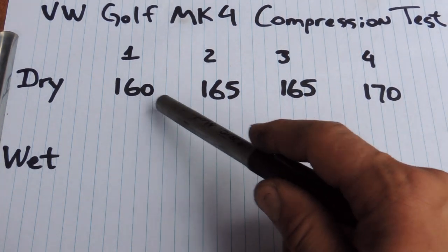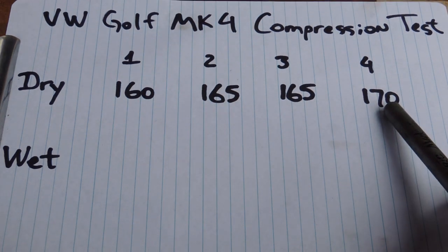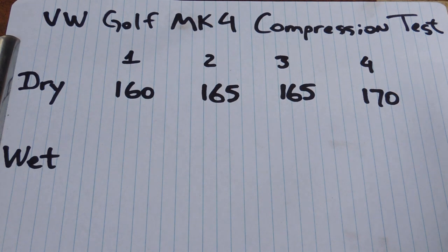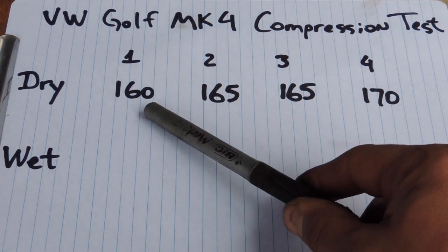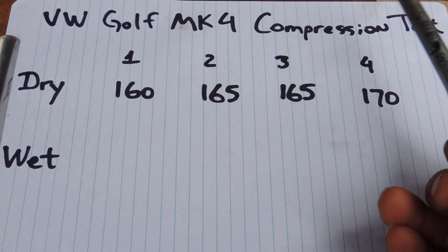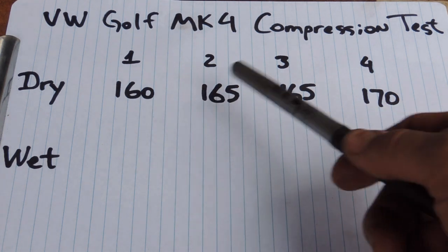As we can see here, they're all pretty much within a 10% limit. If compression at 135 psi is considered excellent, ours is even higher — which is great. If you read compression at the dry test lower than 100 psi, your engine is wearing out. These numbers are really exciting — I expected to see 120–130, but this is even better than expected.